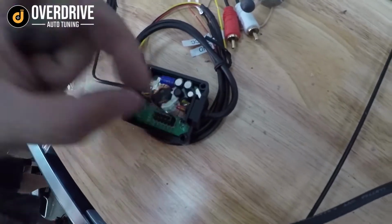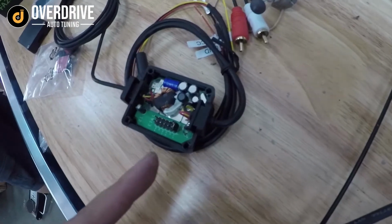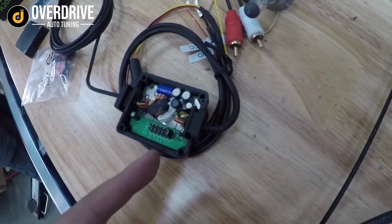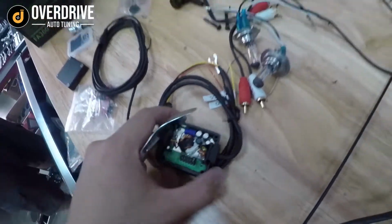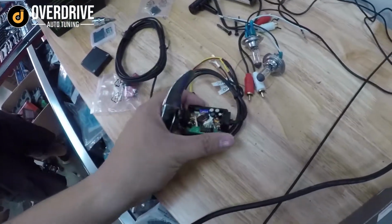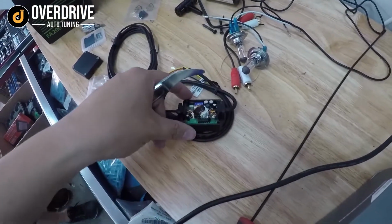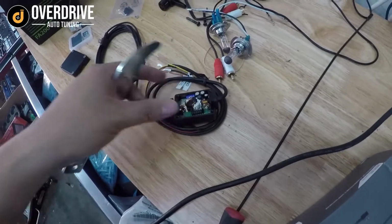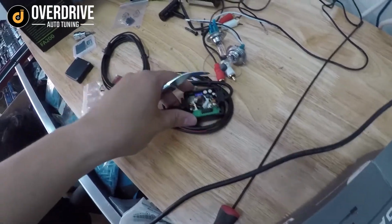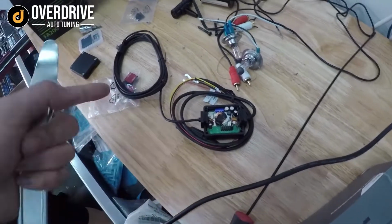So what you do is you move this connector here and you move it to your desired voltage, which we probably will do 12 volt. 11.7 is quite low for most cars. This is also quite bulky, so keep in mind, compared to say a Thinkware hardwire kit, this is going to be a lot more work to hide. It probably won't fit in like a headliner if you need to do one of those installs. But it is necessary to get parking mode out of your Garmin dashcam.